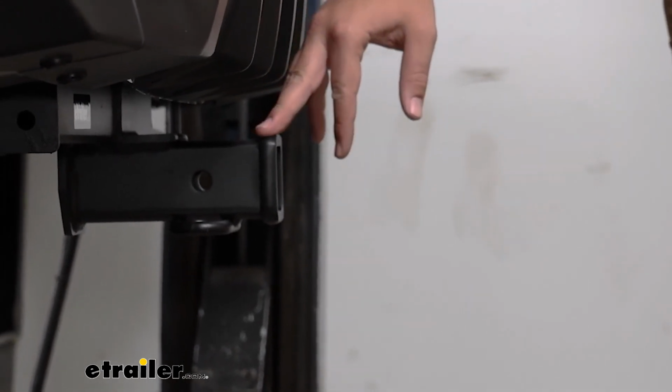As long as you don't have an accessory, you should be fine. When it comes to the installation, this installation is not bad at all. I'd say the hardest part is probably drilling out an access hole. You'll have to remove 2 rubber plugs, and then on the forwardmost access hole that we're using, we'll have to drill it out in enough space to be able to run the hardware up through it, because that's how we're going to have to drop them down.